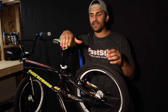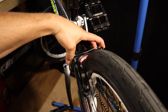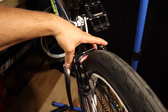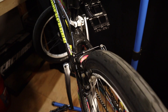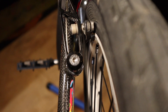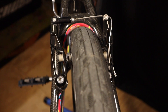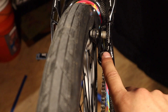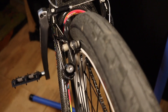You don't want them too tight where they're rubbing the wheel and slowing you down, but also not too loose where you're having to pull the brake lever all the way in just to get a little bit of brake. You don't want them too tight because then they'll rub and you'll come to a stop quicker than you probably should. The main goal is to have them not too far apart but also not too close, so your wheel spins freely. On mine, both sides are pretty even — I try to keep them about the same so when I pull them they hit at the same time.